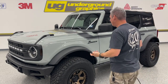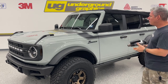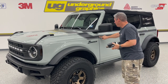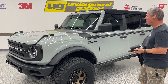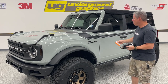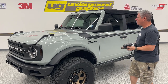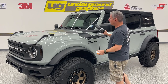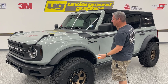As I got the other side finished up, I did notice as I was getting that stripe down and went back with some heat that there were some small air bubbles coming up — just small things. You do want to go back, I do recommend that for this kit. I think it is due to that air channel — we're getting our finger in there to push that down to get that out. If you don't have a heat gun you can use a hair dryer, but we do recommend a heat gun. You do want to get it pretty hot. If you put it outside in the sun you're going to see little spots start to come up — you can take that soft squeegee or a microfiber and push down lightly. If you do it hot you have a chance of putting the adhesive imprint in that vinyl, which you don't want. So again, that's why you want to do this indoors when it's cool — heat that up, let that cool off, and you'll see where those are going to appear. When they come up, take the heat away, let that cool for a minute, go back with that squeegee or your thumb or finger to push that back down.